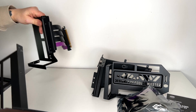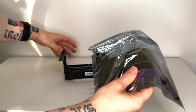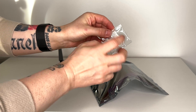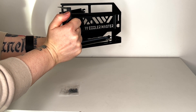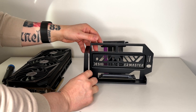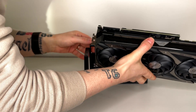All right, let's install this inside the case. The first thing to do is to install the PCIe cable on this support here. You can use these screws — you have to pass it through this hole and install it here. Once we are done, we can install our GPU just to check if everything fits perfectly.